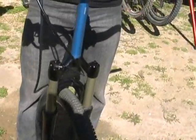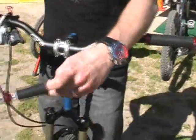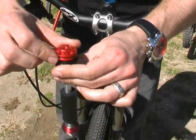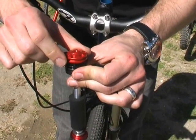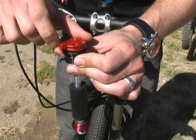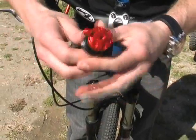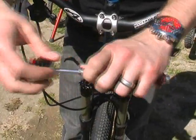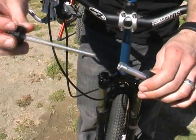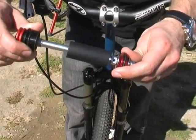The low-speed damper is called Speed Needle, and it's a needle-based damper. I've actually got one right here. The low-speed damper is externally adjustable. In the closed position, the fork is effectively locked out, except for the high-speed damper. And in the open position, it's open. The needle itself looks like this — a tapered needle that moves up and down into an orifice, and as you thread the needle in, it makes that orifice smaller.